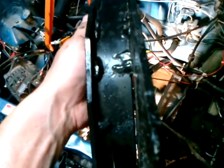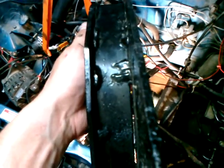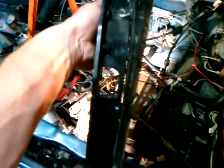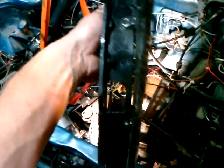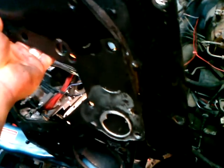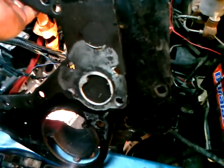What I've got to do is make these two plates about 18 millimeters closer together. There's enough room for that, but I'm going to have to play around with the nuts and bolts to make sure I've got enough clearance to get everything back together. It'll involve cutting this apart, grinding it up, and welding it back again.